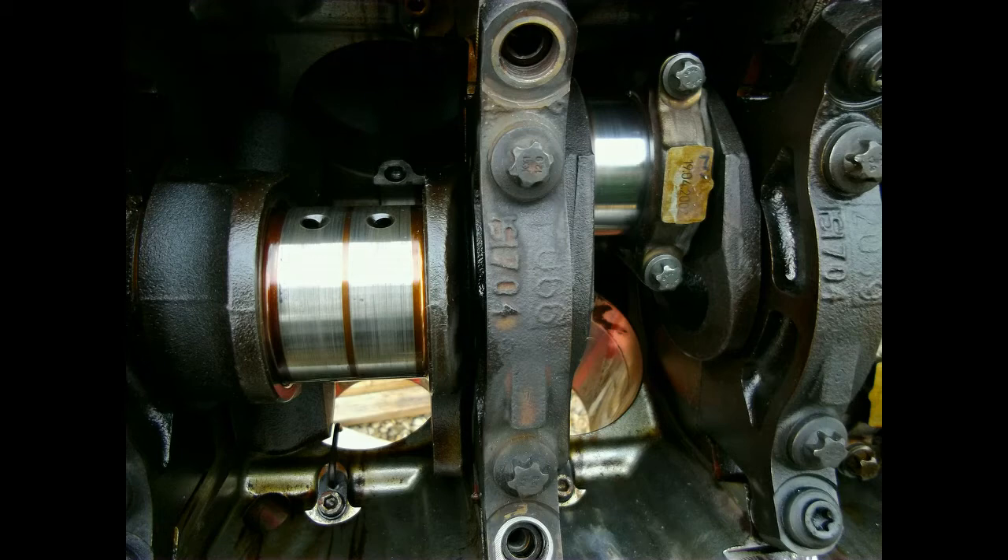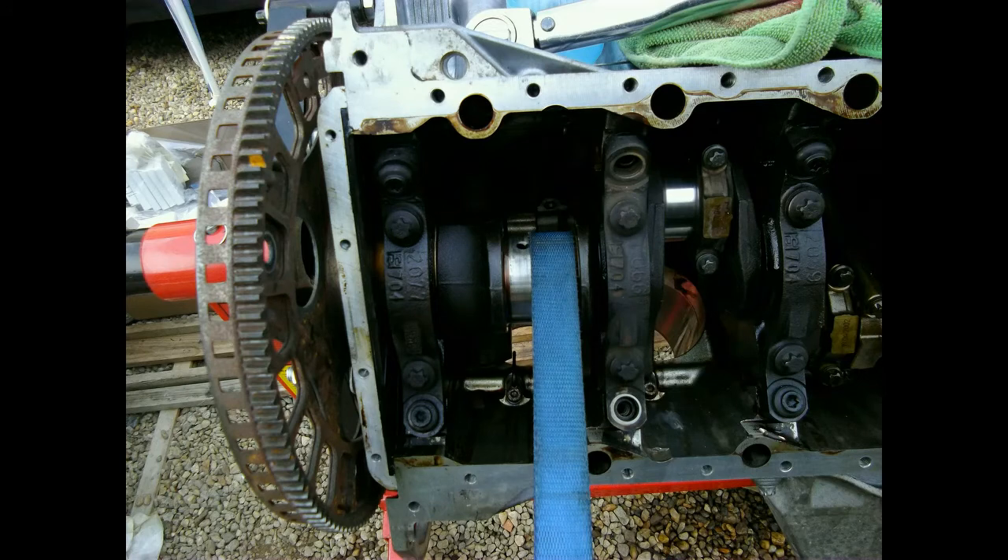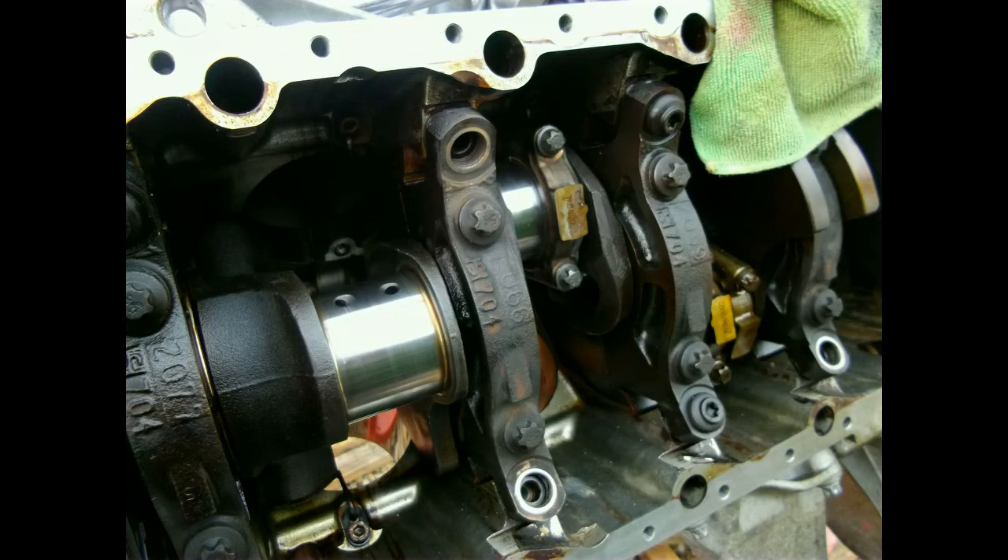Also took the next pair of pistons out. Here is how I polish up the cranks: I use a cargo strap which is made out of nylon fiber. It will not damage the crank but it will take care of contamination and very light scratches. Passed it three times with different grades of rubbing compound which gives a very smooth surface — and then this is the result, nice and shiny. If ever there will be scratches left after this process the crankshaft has to be brought to a machine shop specialized in grinding. I do have a lathe but crankshafts are very precise — I would never attempt anything like that myself.